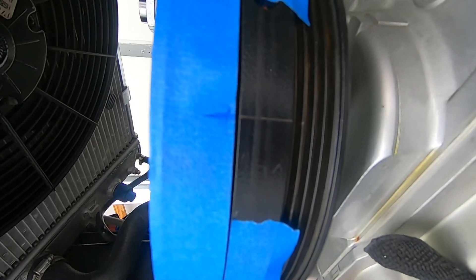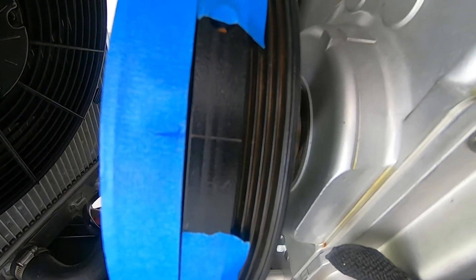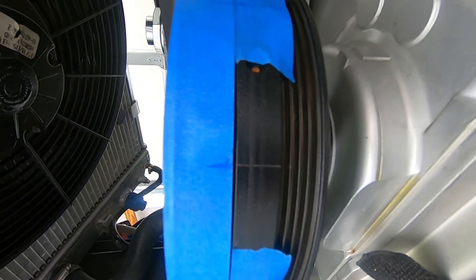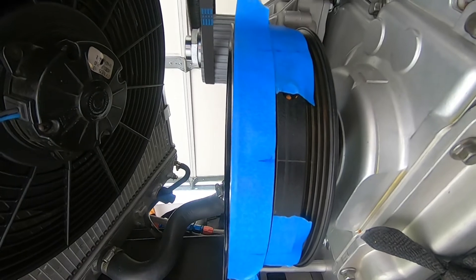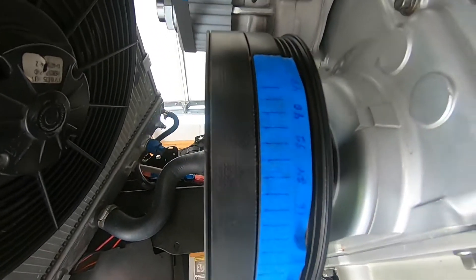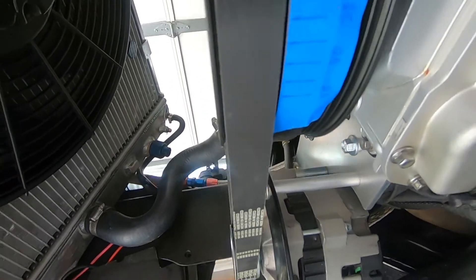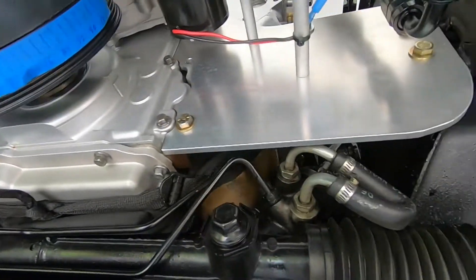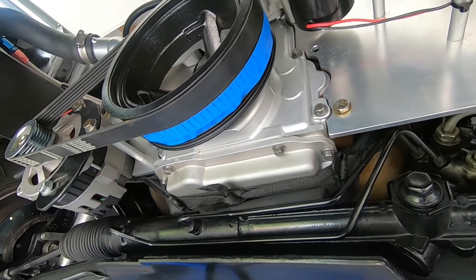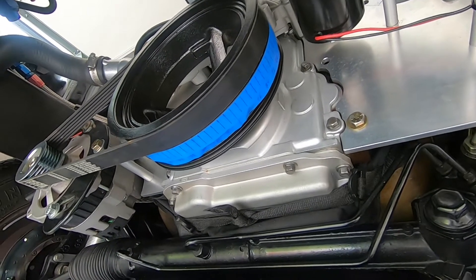Transferred the marks, found the halfway point, and went ahead and made a scribe mark on the balancer — just scraped it across. The balancer is already painted so it's easy to scribe across it. We'll make another piece of tape to go on top of where that scribe mark is — that's going to be our zero. Once that's done we'll have the degrees combined and can find out where the timing is on this motor. We've got a fancy timing indicator with timing marks on both sides just to make sure we don't miss anything. Next task is to reinstall everything — plugs, valve cover — then get the timing light out and fire it up.